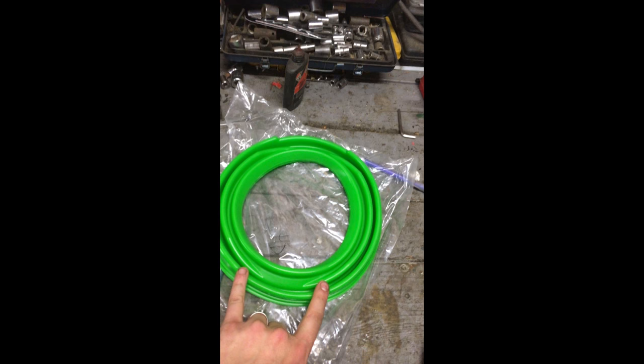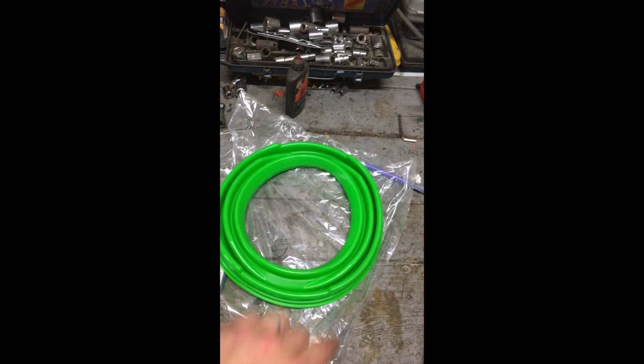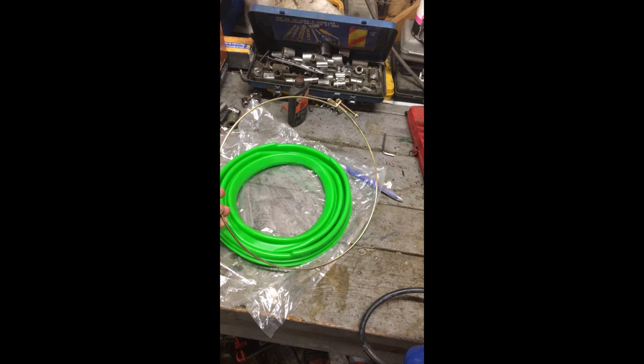Here's the new seal I'm putting on. On the inside, the outside — these little cutouts, one here, one here — I put them side to side from the wheel, not up and down. I'll show you that. Here's the outside band clamp.